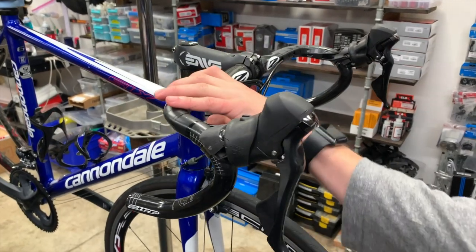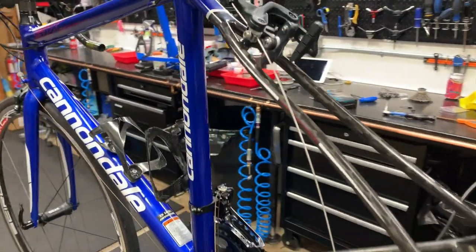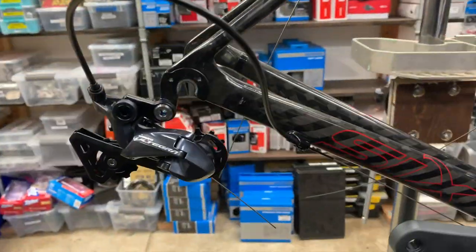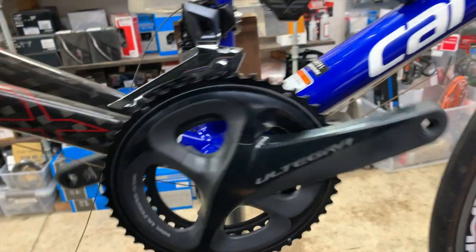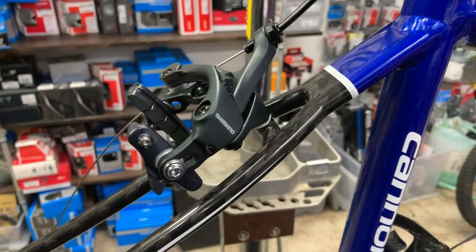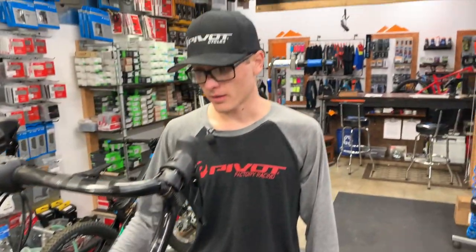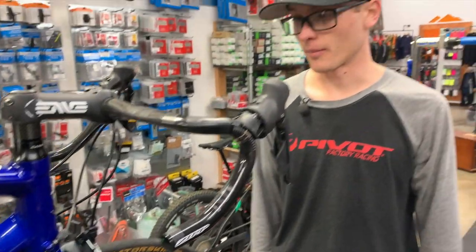Since you last saw, we left off with the right side of the cables and housing. We've got the left side finished up now. Both brakes are on with the housing in the rear. We've got the rear derailleur housing and rear derailleur on, and same goes for the front. Nothing has been tightened down or adjusted yet — this is all just in place. Fresh bottom bracket, fresh crankset on there, still have yet to torque that. Right now I've got the front wheel on the bike and I'm doing some brake pad adjustments with some minor cable tension. I'll go back in, pre-stretch the cable, and then do a final cable tension adjustment once the brake pads are set.